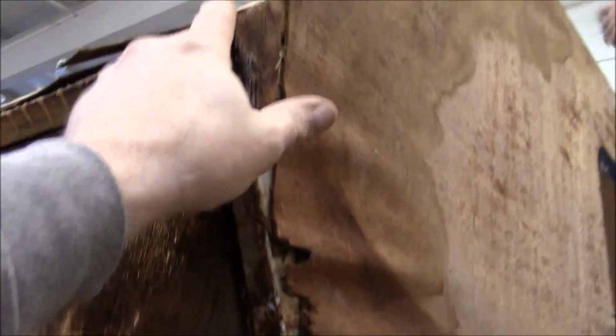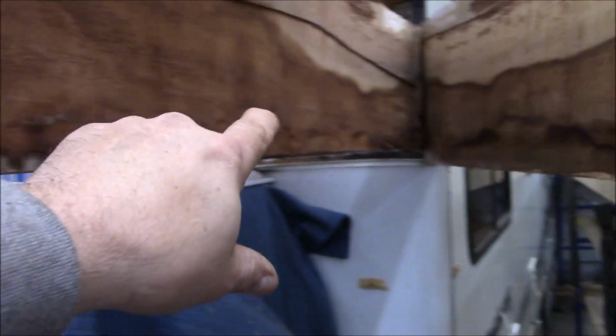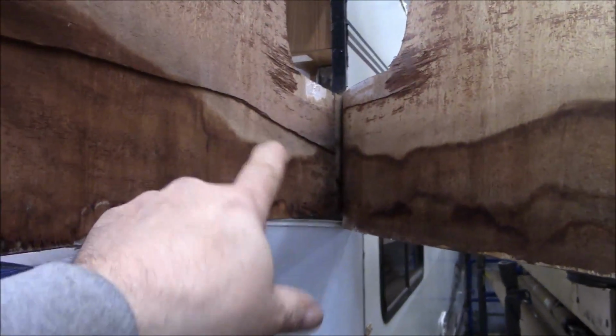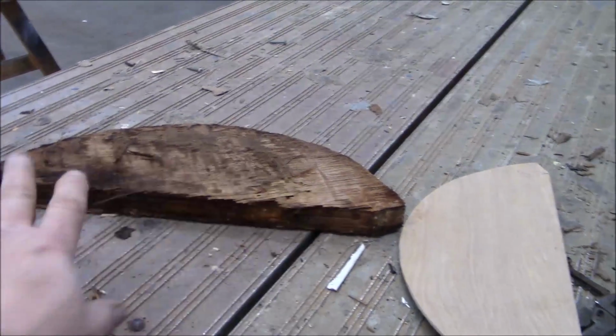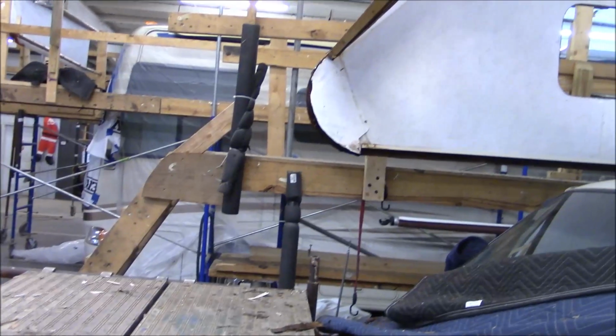And it actually had wicked up. There's a lot more water here. So it probably wicked up this way and had a little bit of leak, because when we took this piece off, someone had wadded a whole bunch of caulking up inside the track to try to cover the screws as well. So you can see how far back it's traveled, and that's why we're trying to open it up, and then we're going to get a new piece in there and get that right. So now that tells me this piece is wrong. That's straight up wrong. So my next thing is to make my adjustments. But prior to doing that, I'm going to go over to that side and make sure that's true, because this has to be perfect. If it's not perfect, that fiberglass won't come around and won't sit right.